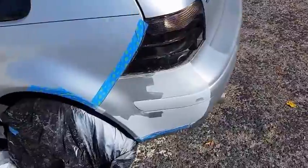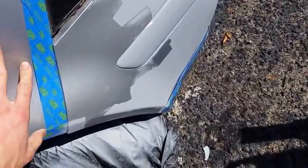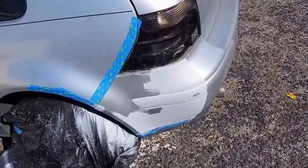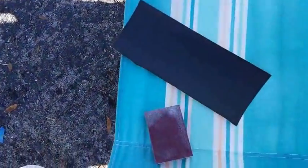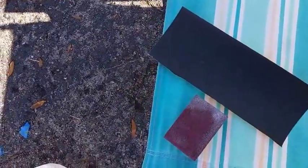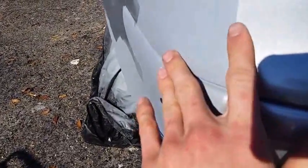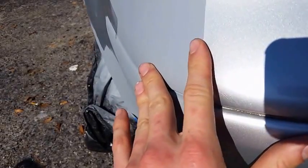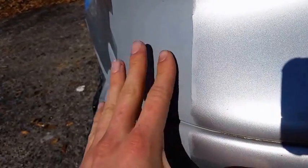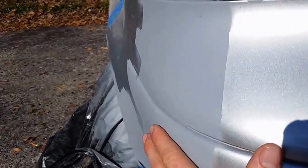The primer dried overnight. I've taken off most of the masking tape and paper, but I've left masking tape along the panel edge so I don't sand the good paint. I'm going to wet sand with 800 grit — my friend recommended 600, but I only have 400 and 800, so 800 it is. I'll wrap the sandpaper around a block to disperse the pressure of my fingertips and get a flatter sanding plane. What's interesting is that the sandable filler primer left a noticeable ridge where the tape was, so the main goal is to feather that out into the good paint and get everything nice and smooth before painting.